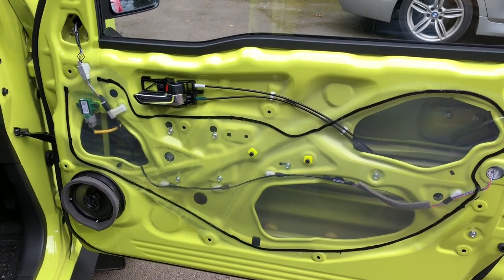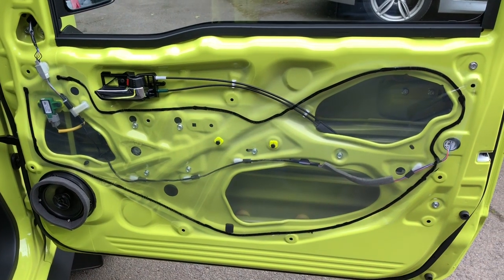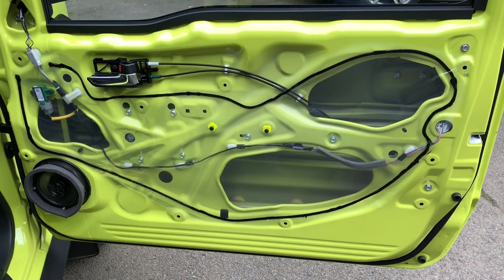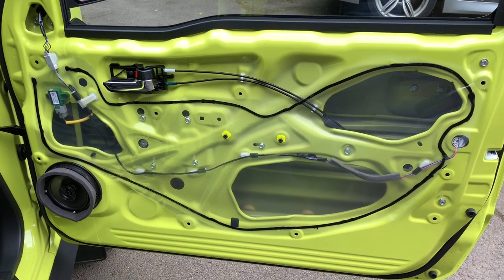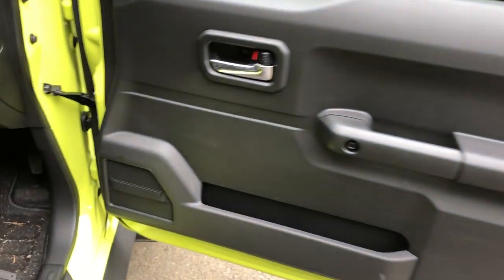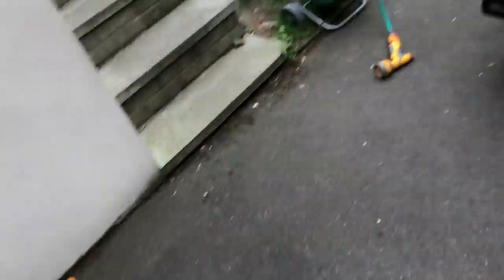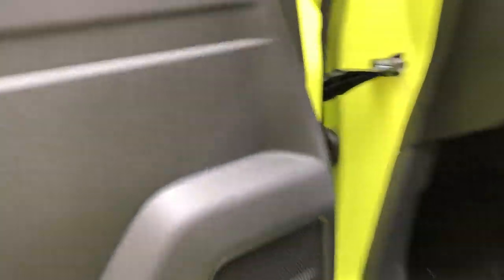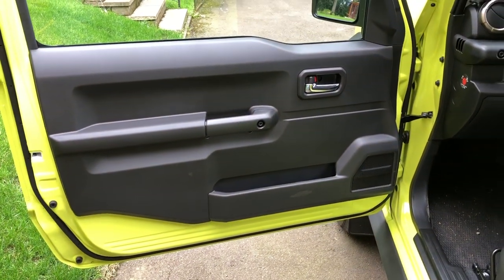The sound is definitely working. We can now reapply the door trim — the exact opposite of how we took it off — clipping it in from the top, working around the edges, securing in the middle, and replacing the screws. That's the panel trim replaced and the speaker is still working. Interestingly, with the new speaker on this side and the original still on the other side, there is a distinct improvement in sound quality on the side where the new speaker has been fitted. Excellent — time to dismantle the other door and do the other speaker.